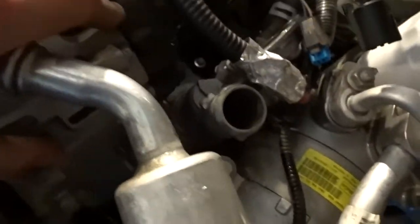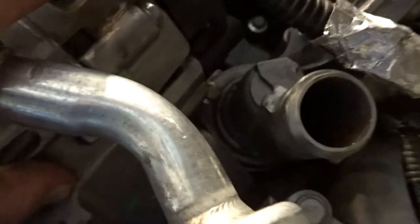So this is a nightmare. I had to take the belt off because I had to loosen up the alternator here to be able to move it so I could get that bolt back there on the thermostat housing. To take the belt off, you just have a little 17mm bolt right on that tensioner, so I just used an open end wrench.